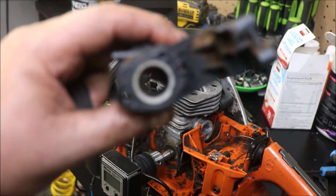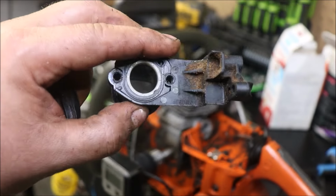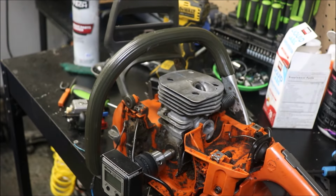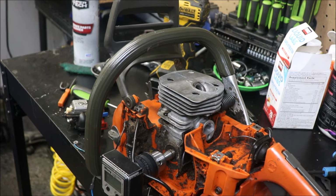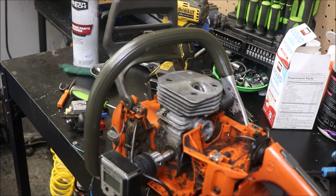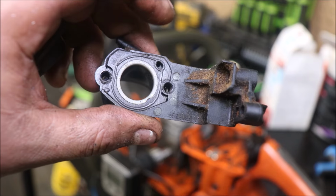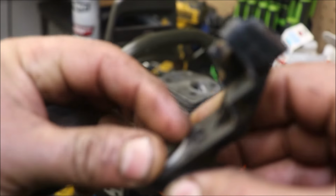Now that is not what I'm used to seeing when tearing down a 350, and I've torn down a bunch of these. That's a 359 intake boot and ring. I don't know, maybe some of these could have come with those on it, or maybe at a dealer repair they just threw it on, but it did have that old style partition, and I swear I don't think any of the 359s, maybe the 357s may have had it. Any of the ones I've had here and torn down had that newer partition and that little squeeze together metal clamp that everybody loves. But that's definitely a 359, 357 intake boot and ring. The 350 intake boot is somewhat smaller, and the ring that goes in it is kind of long, kind of a sharp thing, if that makes any sense.